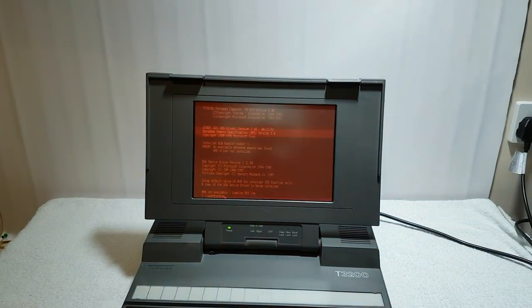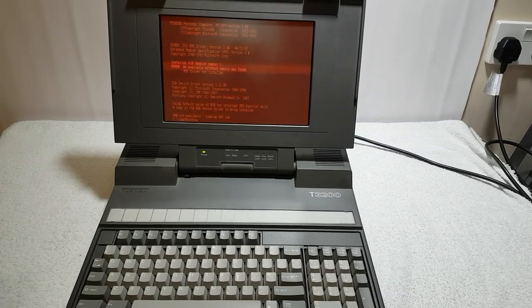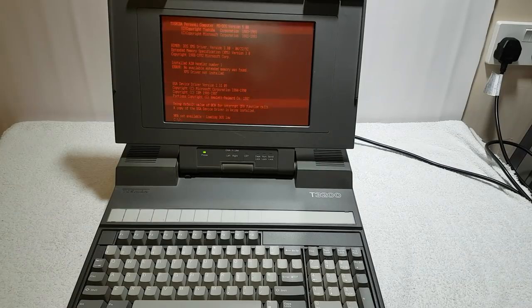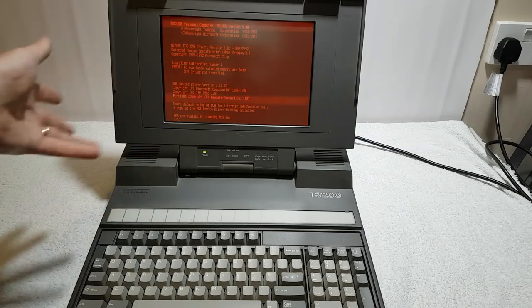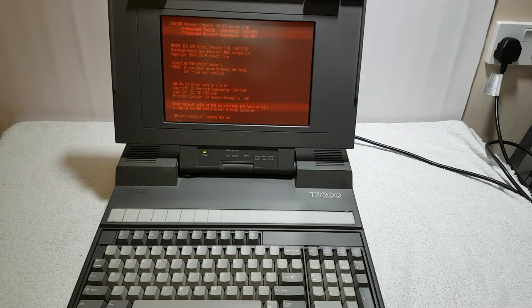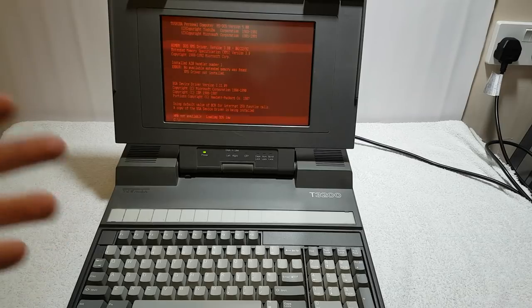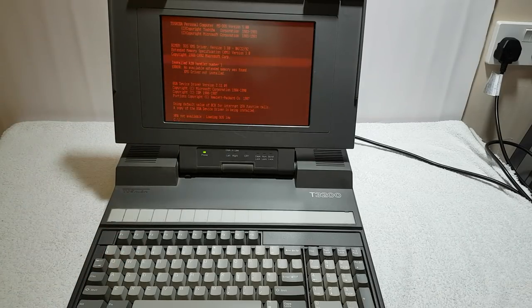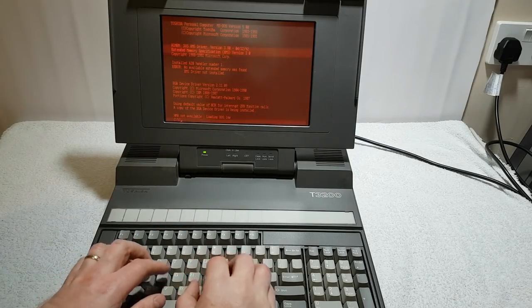Now I can smell something coming out of this. The reason Callum passed it on cheap was because it emitted smoke. He switched it off, then put it on outside on a board to check if it still worked, and it fired up fine. I initially thought it might be a motherboard battery, but it turns out it's likely a tantalum capacitor that's gone on an expansion board.